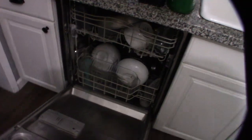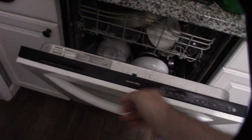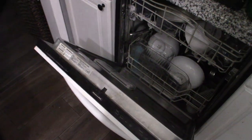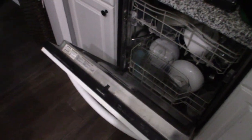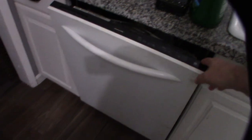I've worked on this thing so many times I'm just going to take the screws off — one, two, three, six screws and the front panel should come off. The reason I don't think it's the latch switch right here is that even with the door open I'd still get power to the control board. That's why I'm really thinking it's the thermal fuse. I'll take the panel off, grab my multimeter, and we'll troubleshoot it.